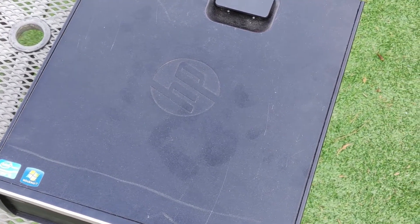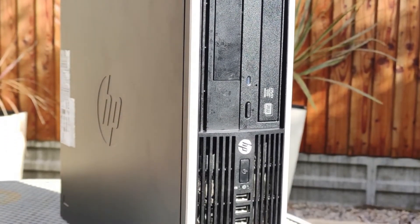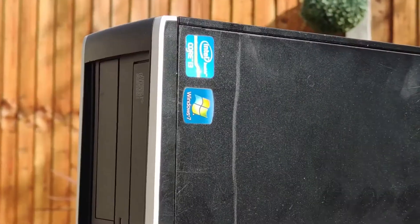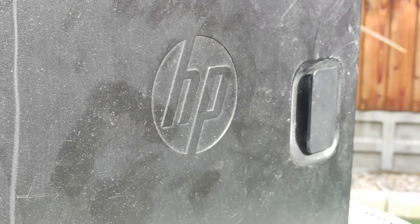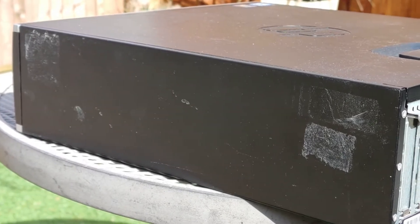This Compaq 8200 Elite is the base model of the Slim Form Factor Edition, featuring an Intel Core i3-2100, 2GB of DDR3 RAM, and a basic 500GB hard drive. It features the Intel Q67 Express chipset, meaning any Sandy Bridge Intel processor can be put in it, making it a versatile base for a useful computer. It would do a great job as a starter home server machine or even a personal computer.